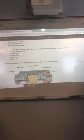It says all steering gears have input. The rotation of the steering wheel is transferred to the front wheels through the steering gear. The intermediate shaft is splined to a worm gear inside a conventional steering gear. Around the worm gear is a nut with gear teeth that meshes with the teeth on a section of a gear called a sector gear. The sector gear is part of the pitman shaft, also known as the sector shaft. Whenever the steering wheel is turned, the pitman arm moves. So the pitman arm is actually what connects the steering linkage. But the pitman arm is connected to the sector shaft.